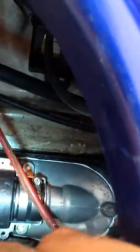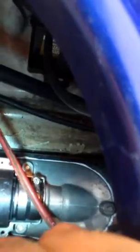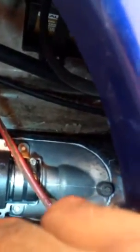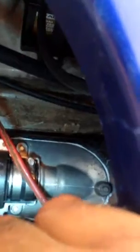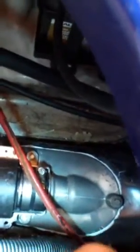And you can ruin the teeth on your shaft, and you're going to have to file them back down so that you can get it in. If you do get this all back together, and that does happen, just pull the pump off the back. Pull the impeller off the back, and you're going to have to clean it up and everything from in there. You can use a file. I've seen it happen. I've had these come in with that problem.